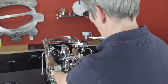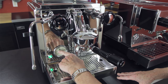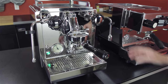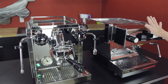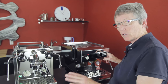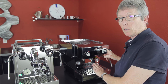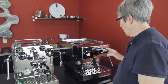Two manometers on the front, just like the La Marzocco. 1 to 1.5 bars over here is where you want your boiler to be. And then over here this is the brew head, what's happening. This is a lever machine - pre-infusion. This has a one-second pre-infusion that's built in from the factory. You cannot adjust, you cannot change it. Also, you can plumb this machine in, but it doesn't come from the factory plumb-ready. You have to buy a plumb kit for this from La Marzocco, and that raises the price up a bit.